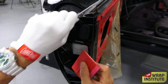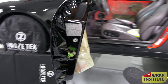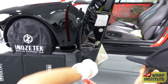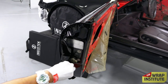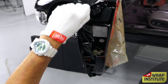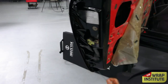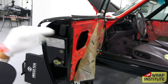This is the trickiest bit of the whole door. Once I relax the material, I take my glove — a really cool one with nice fabric inside that slides and glides — and start to form the material right around to that edge. You can see the material is almost shrinking inside there, and that's exactly what I want. I form it right to the knifeless tape, trying to get there without any wrinkles or tension. You can see the super high gloss of this material — amazing. Once that's down, I pull the knifeless tape. I get this nice overlap on the inside facing in, pull the knifeless tape out, run my finger, seal the deal. This side is done — there's no way the client's going to pick up an edge.